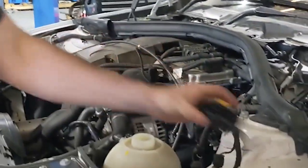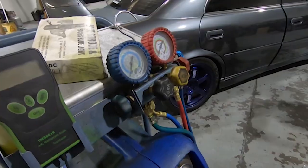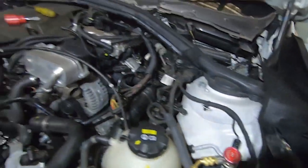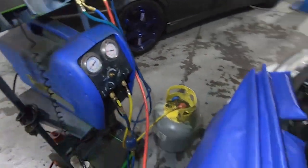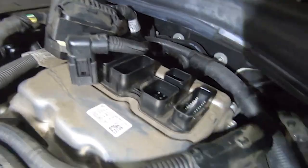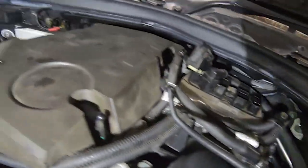We'll take the cooling cap off so we've got some air that can go in - we'll drain that shortly. This is our air conditioning evacuation machine - it's just taking all the gas out of the system so we can disconnect the lines which will come off the AC condenser. We've got our engine harness mostly disconnected from the body to the engine, with a couple of tricky lines at the back of the firewall possibly, and I think that's just about everything in the bay.